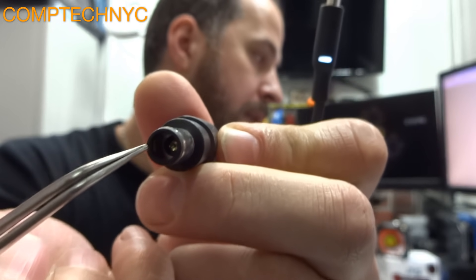To identify the problem we have to look at the way the charger works. Inside the pin charging jack you have one pin right there — a small little pin. That pin is connected to a transistor inside the charger, which allows the computer to communicate with the charger and identify that the proper charger is being used — one manufactured by Dell or a compatible one.